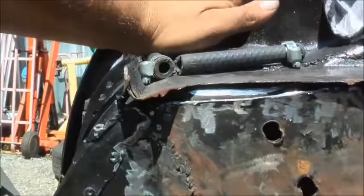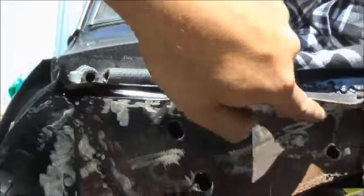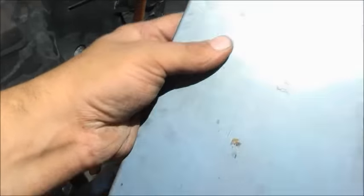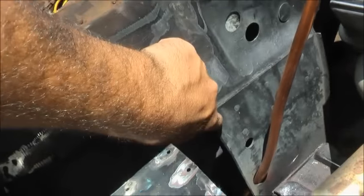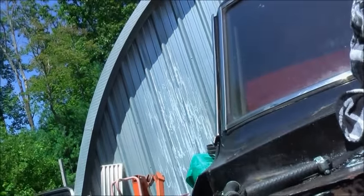I said I was going to put plate and stuff back here on the firewall where it looked like they had patched something up. Found out what they patched up — see that? I'm going to re-weld this, fix that, then put my plate. These plates are already cut out for me. I'm going to put those plates over top of that, then brace it to this, and everything will be one big solid piece of metal. It's adding weight to the car but in places that really need some help. My down bars are going to come off of that down to the frame, so it really has to be strong. It looks like something pushed through or just rusted through and they tried to fix it. Everything was pop riveted together — which we've done before.